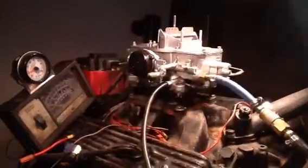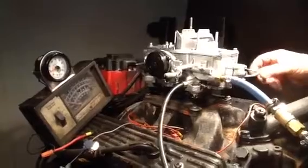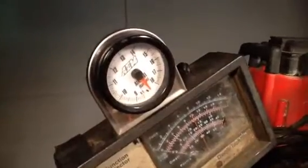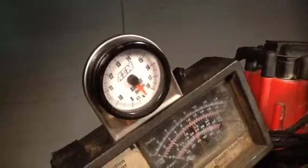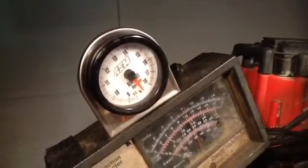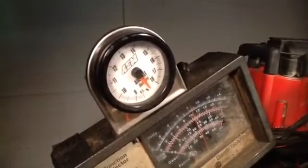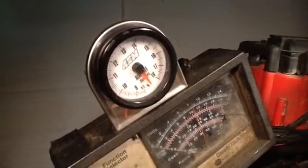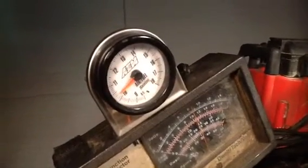You'll see it runs at a perfect mixture. We already got it set right here — about 10, 11 to 12 parts to one — and you'll see it accelerates just fine. These carburetors are quite in demand. You can see it runs real smooth. They use these on Mustangs, and it's not limited to just this type. That's the standard Holley bolt pattern, but they use all the way up to the 4160s, 4150s, and all that stuff.